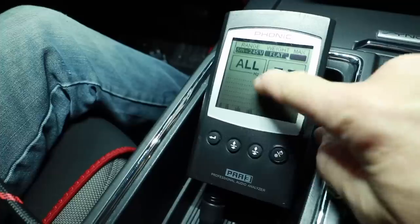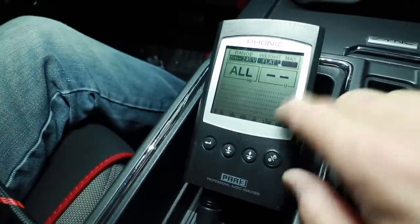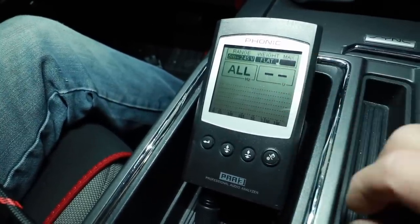If you have a digital multimeter you can use that, or if you have an RTA you can use that. Most of you are going to have a digital multimeter. Set it to AC, which is alternating current — which is what sound is. Roll up all the windows in the car and shut all the doors. Start up the engine with your volume at zero, then rev up the engine and see if you get any movement on your digital multimeter or RTA. Fernando's already in the car with an RTA that has a little voltmeter in the top of the screen, which will show us voltage if there is any.